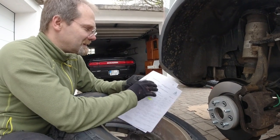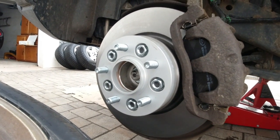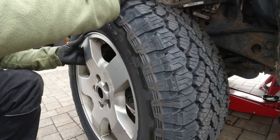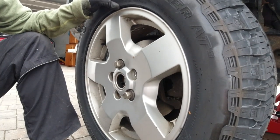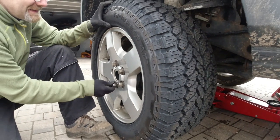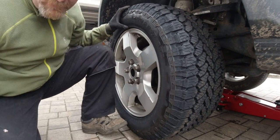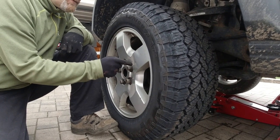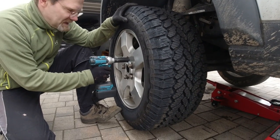That's the penalty for having an Autobahn where you can go 200 miles an hour. On the second wheel, we will count the revolutions so that when the TÜV inspector asks us, we can say yes, we counted them. We turned it counterclockwise until it snapped, gave it a zero mark, and counted — eleven and a half revolutions. So that is for sure good enough. And one obligation was that your wheel has to have holes where the opposing nuts sit — here are the openings, they are important for the TÜV inspector.